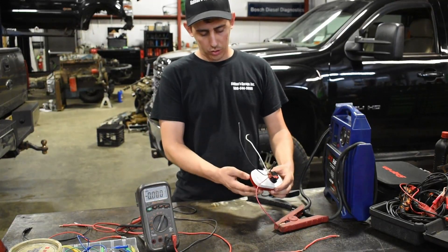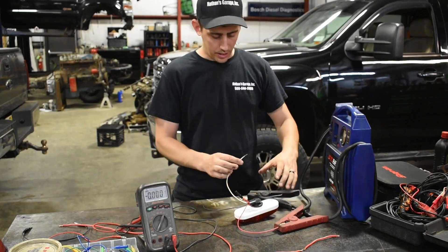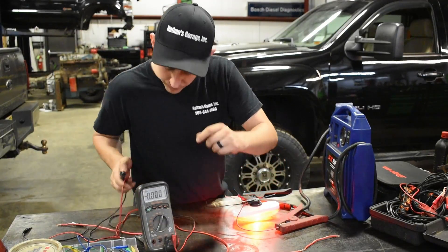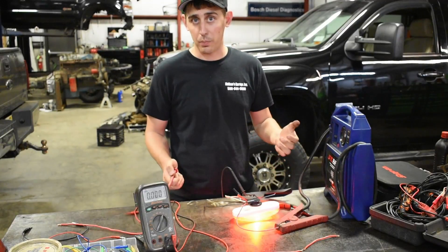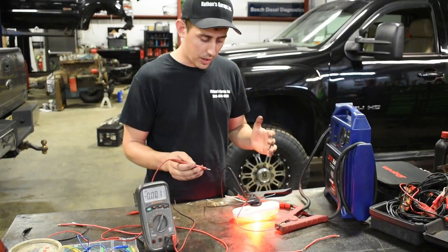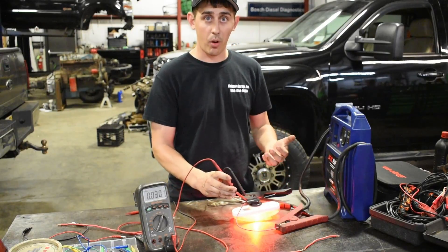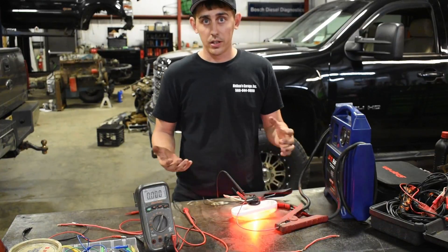What I've set up here is a real simple circuit — a regular tail light, truck light style, with the back probes already installed. We hook up the ground and the light lights up. We go to our meter, set it to voltage, take our ground lead and put it to a ground source — either the body or straight to the battery is the best option. This is how a voltage drop test works. We take the meter and put it on the positive side — it shows just over 12 volts available. Then we take the same lead and put it on the ground side, which is after the bulb, and it shows only about 0.2 volts available. This happens because the light bulb — the load in the system — is consuming all the voltage.